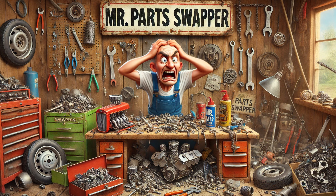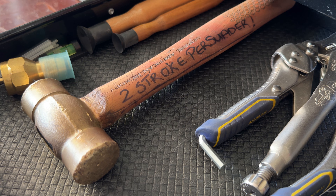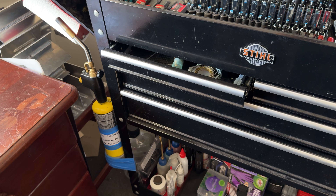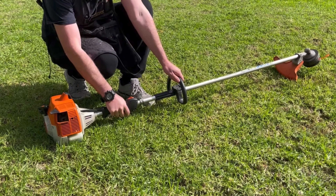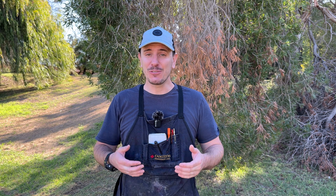The first and incredibly common one I see is part swapping. Throwing parts at a two-stroke engine is a quick way to be left with an empty wallet, a lot of frustration, and a feeling of despair knowing you spent way more than that machine is worth. Although two-stroke engines are simple in their design, they tend to be far more sensitive and require every single component to be just right for that engine to start and run consistently. Not only this, but for many symptoms a two-stroke engine can present with, there can be a wide range of possible causes.